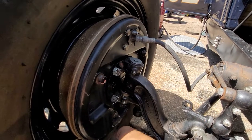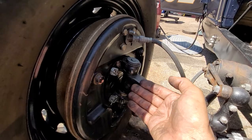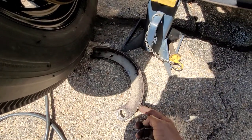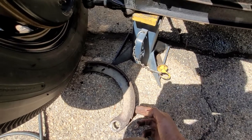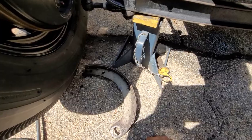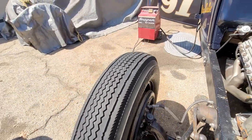Small piston and small shoe in the back, which makes it kind of hard to adjust the rear because the bottom of the shoe doesn't really contact the drum fully — it's a short shoe like we're used to on a primary. So when you're moving it down it doesn't really touch the drum, which is a bit weird.